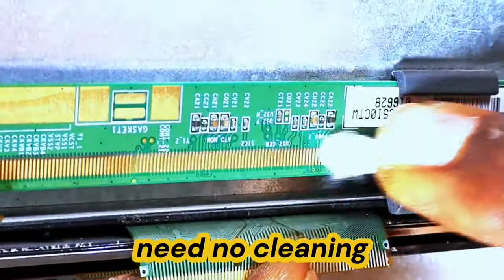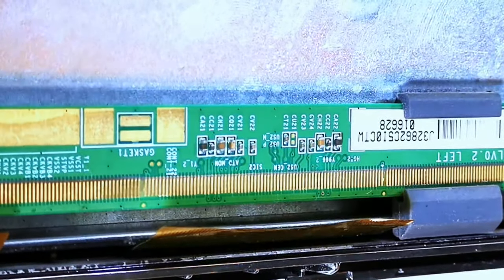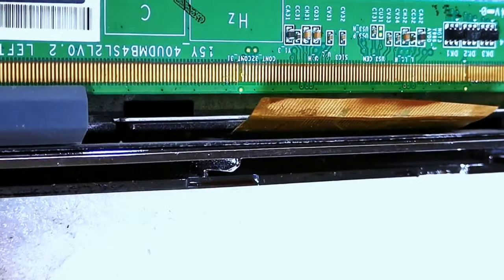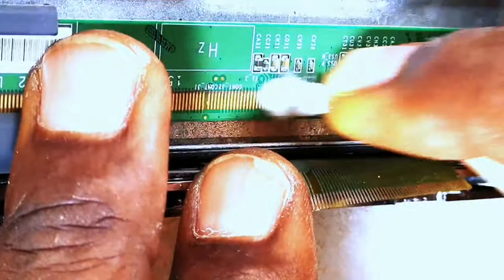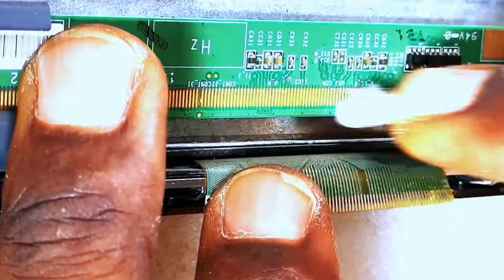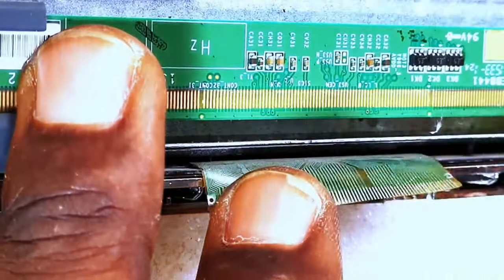While it can be challenging for newbies, it is by no means impossible. The COFs on the panel being worked on aren't damaged. Their flex to PCB bonds only weaken due to moisture. In cases like this, you do not need expensive machine bonding at all since there are no lines on the screen.